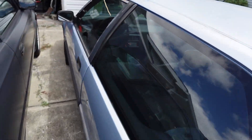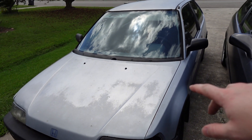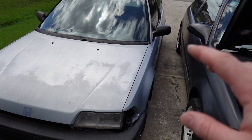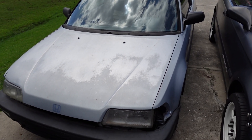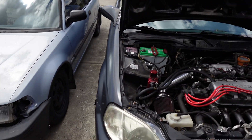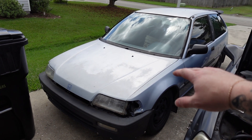This car is going to be the race car. I don't know when the EK will be turboed again — it's fun to drive, not fast, but that's part of owning a D-series Honda. I have a D16 Z6 block torn down right now — everything's in great shape, crank's good, no spun bearings, cylinder walls look all right. The next step is to take this motor to the machine shop to bore and hone it. We're going to do a simple Vitara/Speed Factory setup and build a Z6 engine for high boost for this car. I'll probably put a set of better coilovers on it too, since it has something like Max Speeding Rods which are not super reliable.